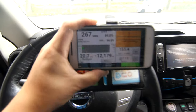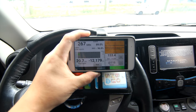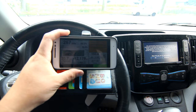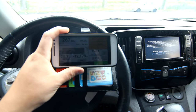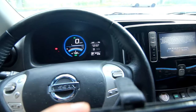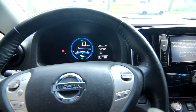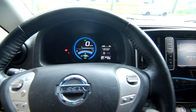I just updated the firmware to reflect the extra capacity — 432 kilometers, which is a nice number. Unfortunately Leaf Spy doesn't like it and doesn't report the actual capacity that I programmed, so there's definitely something different between the EMV200 and the Leaf in how they handle capacity. I also had to modify my program to change this on a different byte in a different CAN message.